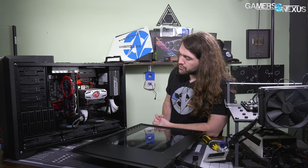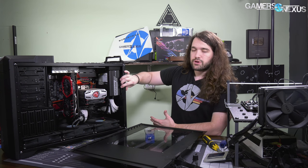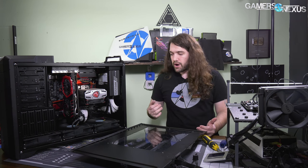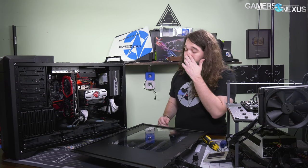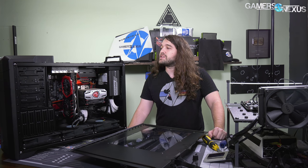Air cooling isn't necessarily interesting to people buying high-end $200 cases — they often want to go open loop. If you were to go high-end enthusiast instead of high-end workstation, you could keep some drive cages but get rid of the optical bays, add some height, and pop a reservoir mount in for liquid cooling support. The biggest challenge is that at that point you'd probably want a radiator sized 180mm times three, because those fans aren't meant for cooling a small radiator. But I still really like the case and think it could still sell today.